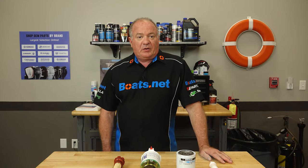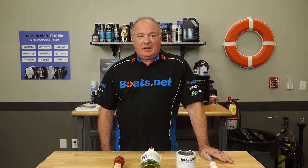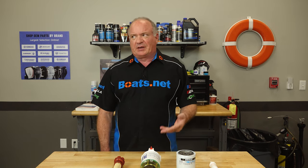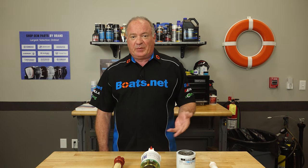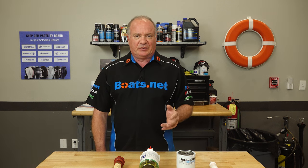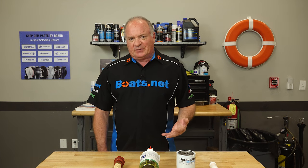Now how does this work? Well, the fuel pump draws fuel through the fuel line into the fuel water separator, and inside you're going to have two separate chambers. The first chamber works like a centrifuge, especially on your larger diesel boats like a sport fishing boat. That pulls from the fuel pump and causes the fuel to spin around, and the water gets slung to the outside chamber because it's denser. That's typically what you're going to find on your larger sport fishing boats. They have a diesel system with a send and return line and enough flow to create that vortex within the system.